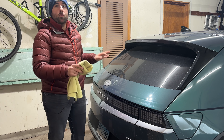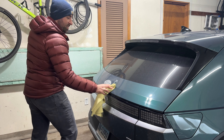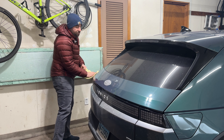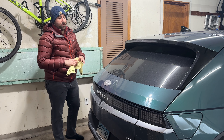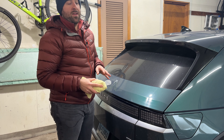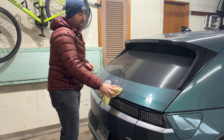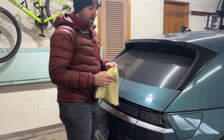For the purposes of this video, just to show you what this looks like on the car, all I'm going to do is wipe down this edge here to expose a nice clean surface of paint, then tear back a couple sections of that foam tape just to hold it in place temporarily while I get some video. You also want this to be dry. It's really cold out today — it's like 18, 19 degrees — so you don't want to install this on a cold day like today. The instructions suggest doing this over 72 degrees, and we're not going to get any 72 degrees here in Connecticut anytime soon because it's still February.